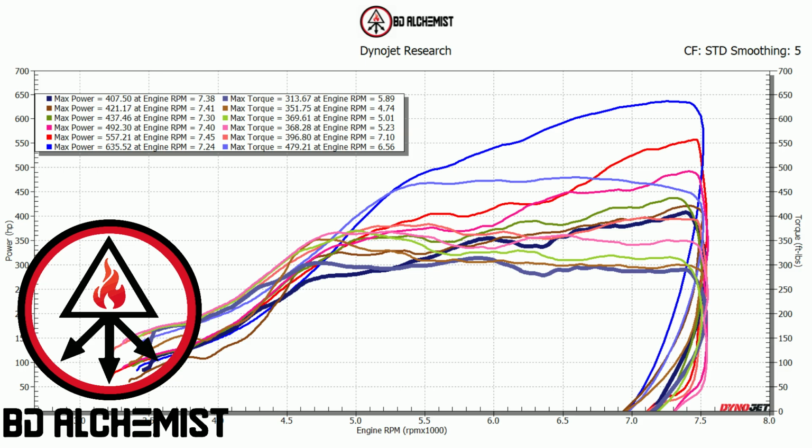This is on 36 pounds of boost, and the timing is still not peaked out. Just to show you what an unsleeved motor can do, even though it's an H-beam, this is probably the limit that I would ever put on it. Miguel doesn't want this. He's gonna go home with 557, 560, and still 400 torque. But this is a very capable car. This thing on the street is just wild, and it's a really fun car to drive.